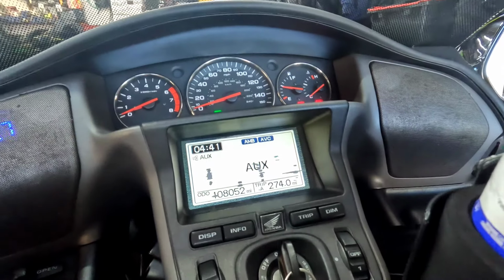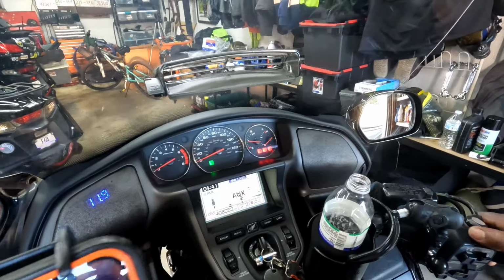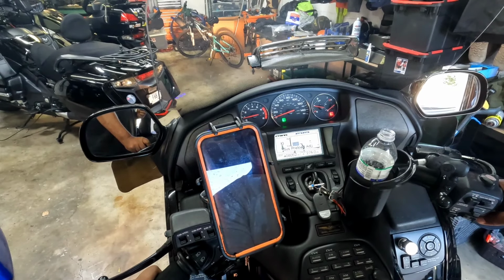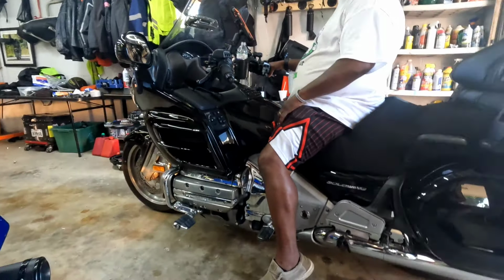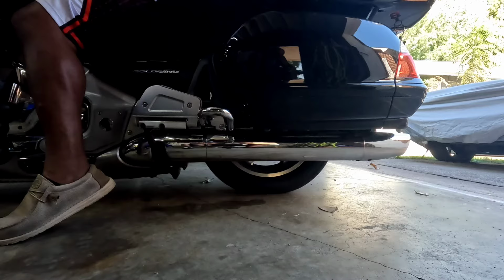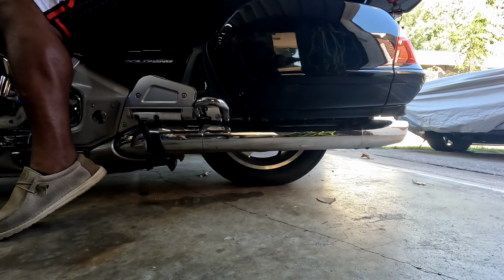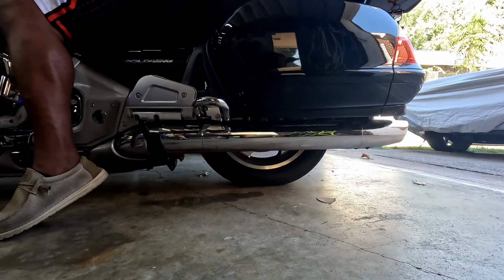Turn it on. Hold on. You gotta crank it up. It's in neutral. I got the switch. Oh yeah, by yourself you need to be on about 10, and then when you get your trailer and her on there, you need to be up around 25. The whole full amount, because you got stock suspension. Because you can already see, take it up to 25 to raise up. That's how you can tell if it needs it. Now it's going up. Can you feel it? Yeah. Getting taller. What's it on right now? 25. Hey, they come already low on fluid, so it's not even half. It needs some fluid in it, but you can stand the suspension up under there.